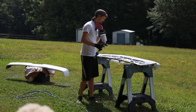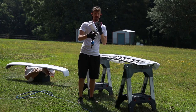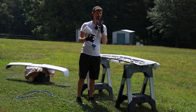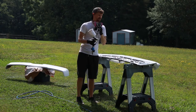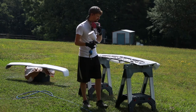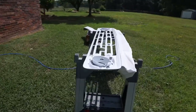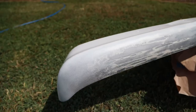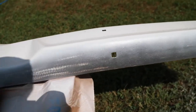I've already got two coats on here and they're looking pretty good. For the very last coat I'm just going to do a dusting — I'll turn my fluid nozzle down so I'm barely getting any paint out, because what I want is a dry spray. A lot of times when you see really old paint on trucks it'll be kind of dry and powdery, so we're trying to give it that look. Essentially putting some bad paint on top from the direction the sun would be baking the paint. I can see where I left the top of the bumper pretty open with that dry spray, and I helped feather the edge in to make it look as natural as possible.